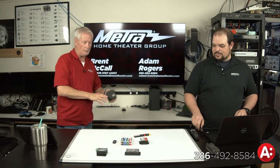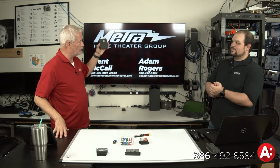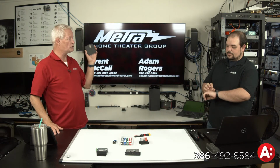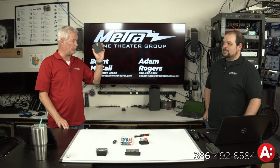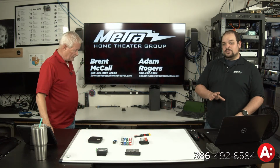So step number 1, troubleshooting. Make sure your display's input is working. Have a source that you know functions. Do not rely on your customers' devices. Have one with you. This is cheap, easy, and it's tiny. And it needs to be something that you periodically check for your own equipment.